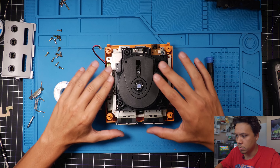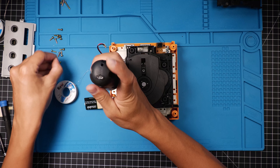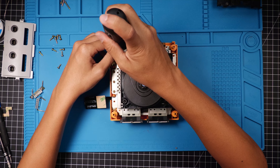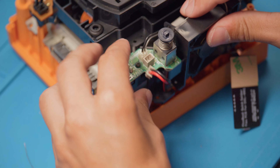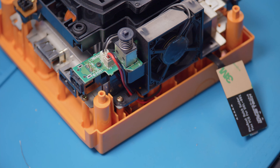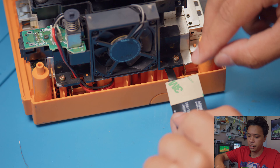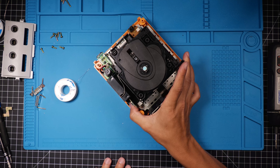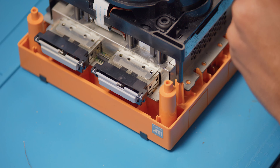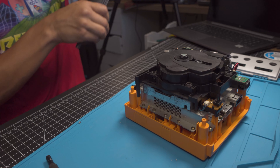I'm going to start on the bottom leg. That one's in. Start in the middle — one of the middle points over here. What I do is I kind of tin the pad a little bit on the top right there where it's gold, and then I kind of just sweep it over. Just like that. Now we only have two more. That should be good — let me get a closer look. And it should look something like that.